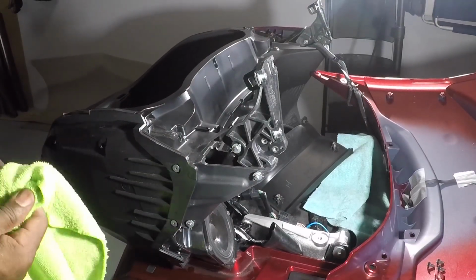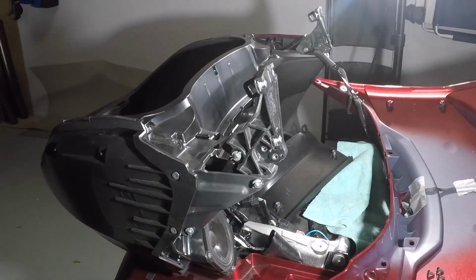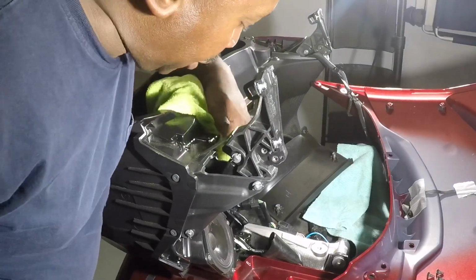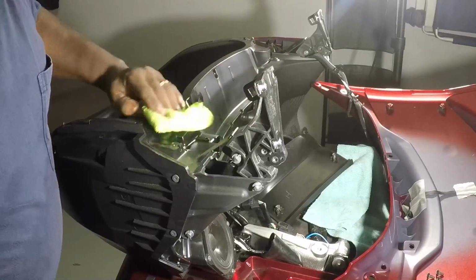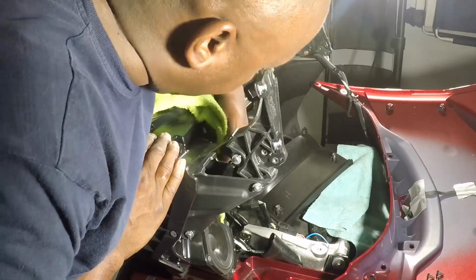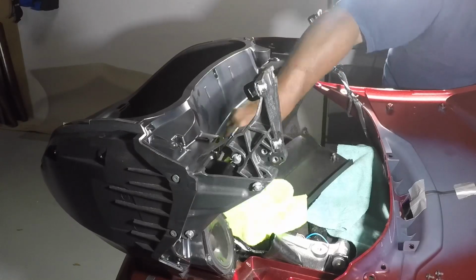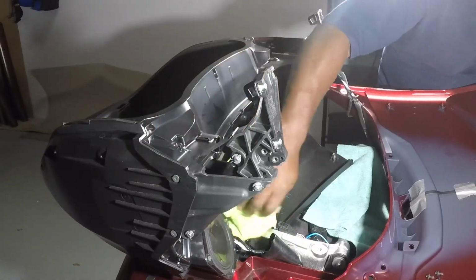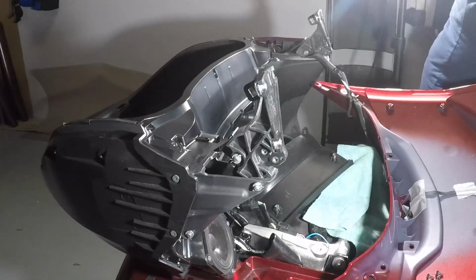With a clean terry cloth and alcohol, we clean these plastic surfaces in here all the way down. You're going to run this wire and attach it with adhesive. So just clean off everything around up in here. Along the rock, you can come up through this way, along to the deck up here. Just clean off real good. Make sure adhesive sticks.